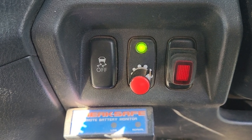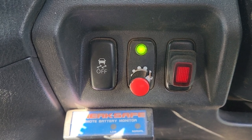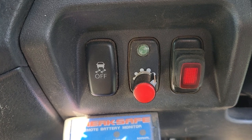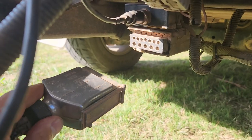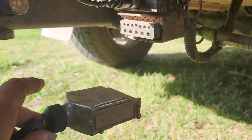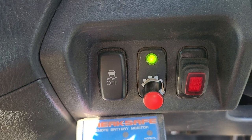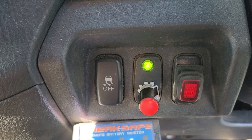Now my vehicle's got a brake controller attached to it. We do a lot of towing as you'd expect when we're travelling around Australia, and from time to time I've just had the brake controller disconnect. That green light at the top would just go off for no apparent reason, which meant that the brakes weren't working — which is a big problem if you're coming down hills. I spent a lot of time at the back of the vehicle around the trailer connector wiggling things, replacing connectors, checking the wiring, because I was convinced the problem was somewhere back there, but that never solved it. The only common factor was that it seemed to happen when the car was hot, and we could think of no reason why that would have anything to do with the brake controller disconnect.